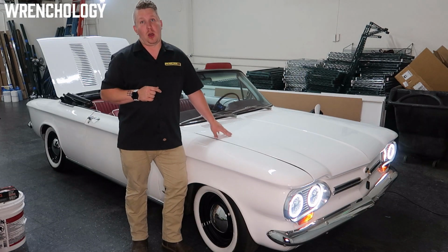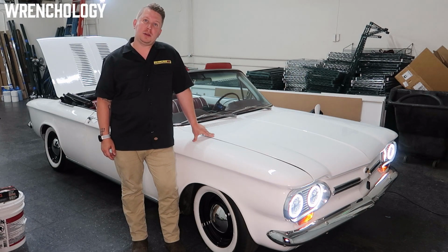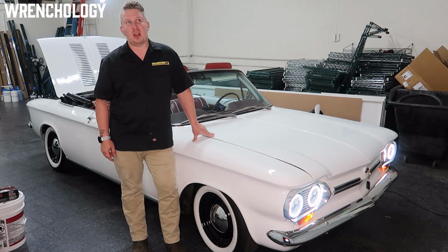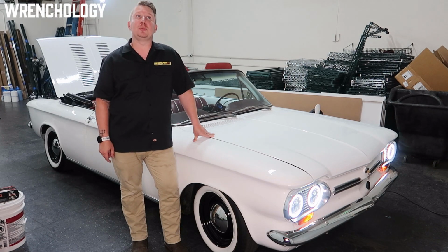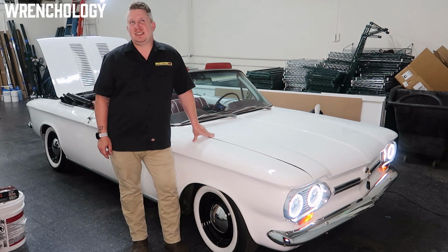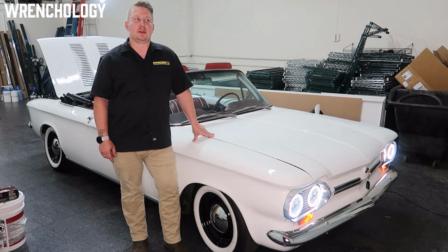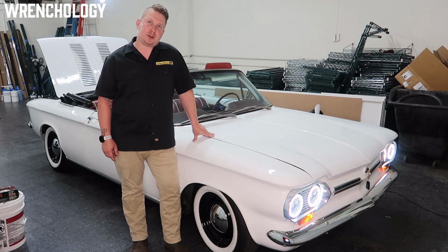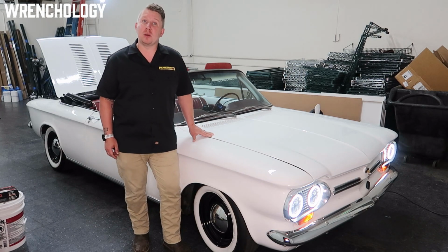Charge time on this car. We have a pretty small charger on this. We've got a 3.3 kilowatt charger on it, which does up to about 32 amps of charging. In miles per hour, it gets you 10 to 12 miles per hour of charging, if you want to look at it that way. The downside, if you're doing the math in your head, is that a totally discharged battery is 7.5 hours of charging.